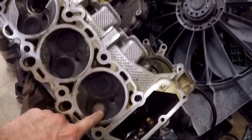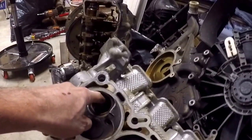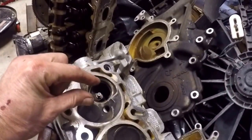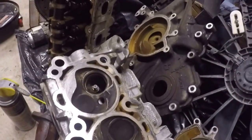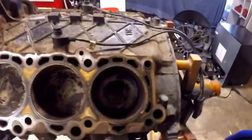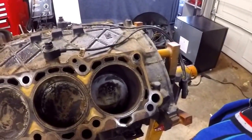So here are the exhaust valves and intake valves on the various cylinders. This one — it's gone. We found it actually; it was in the cylinder. You can see the shaft in there. It literally sheared on the shaft — it left a little stub on the valve base and sheared off, and the valve stem is still down in there. Very strange. These are interference motors, so it takes a lot less than dropping a valve into a cylinder to cause damage — and you can be sure this caused damage. Here's the cylinder in question. I'll show you better when the piston's out, but it's in a bad way.